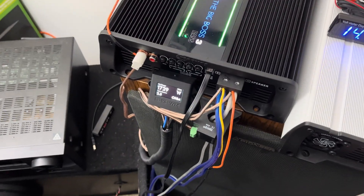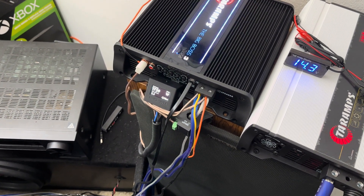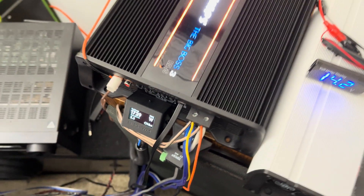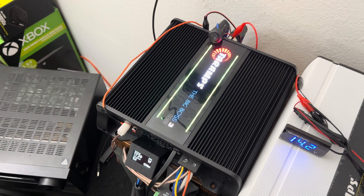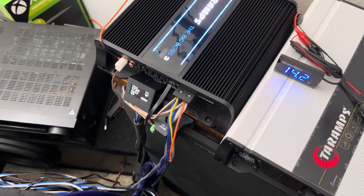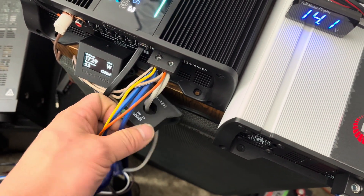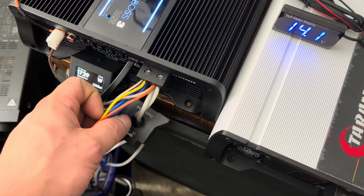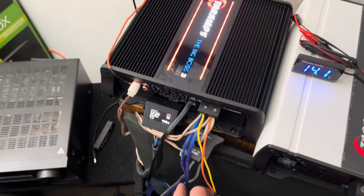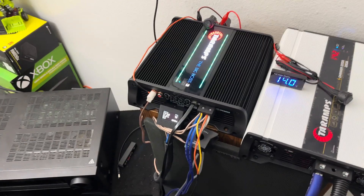Four gauge — I don't know guys, it's exactly the same as the AGMs. That's super confusing. I don't know what's going on here. 2.3 ohms — pretty much the exact same. It's supposed to get that at 4 ohms, and I'm only getting half power out of this. I mean, it's a full bridge — is there something weird about the way the clamp works? Because I know with full bridge amplifiers there's voltage coming through the positive and the negative on the speakers. That's one of the few factoids I know. So I don't know guys — I'm getting a lot of voltage drop too, and it's coming through the same. That's so weird to me.